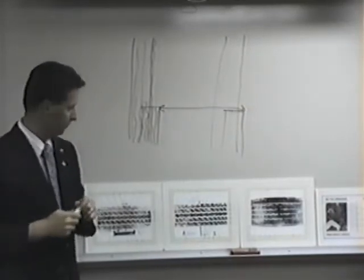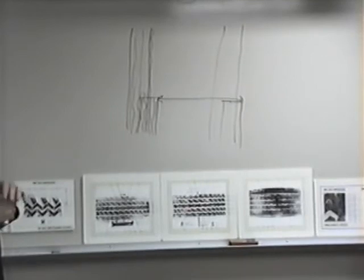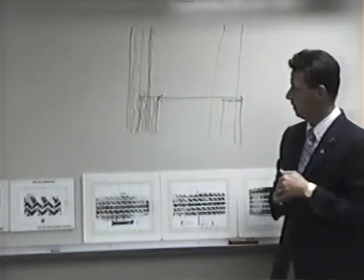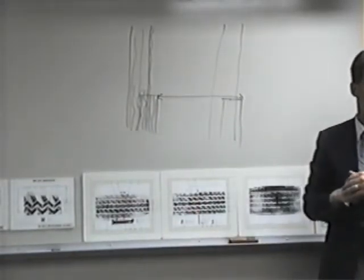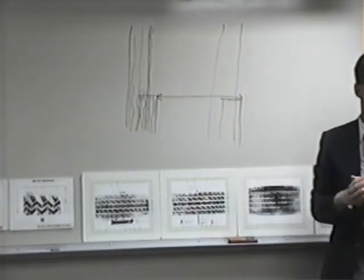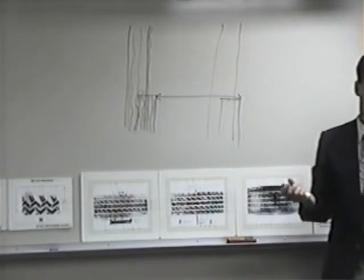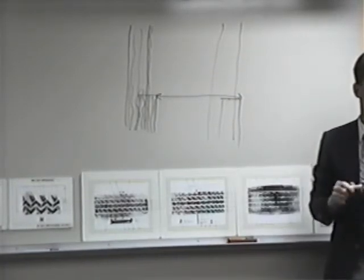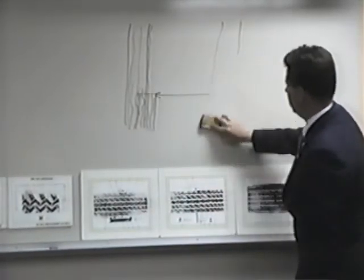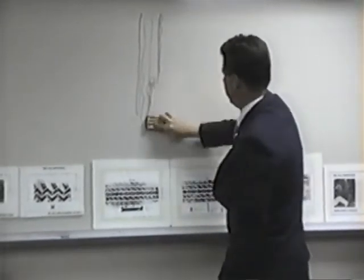Okay. One thing that I learned that I didn't know was that if you have both front and back, you need to measure both front and back because they're different as far as track widths. Yeah. Or they may be different, the front being more narrow. On some vehicles there's a 3-inch difference. On others, there's a 1/2 inch, that's all. On some vehicles, they're virtually the same. So it does vary. But whenever possible, you want to try and record the front and back.